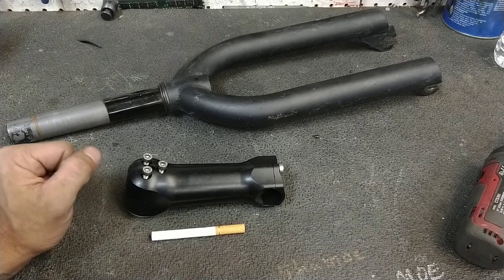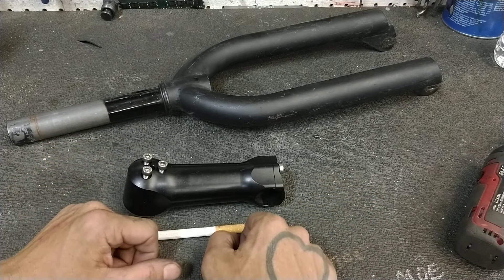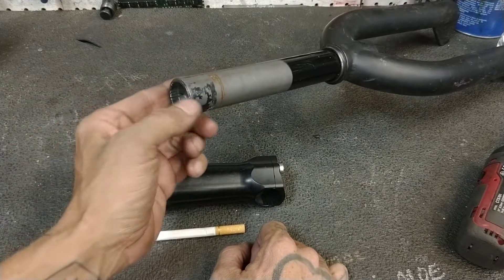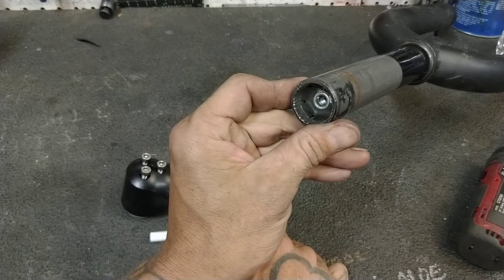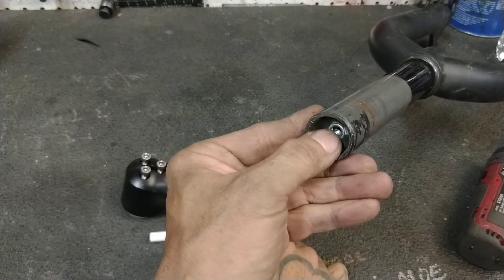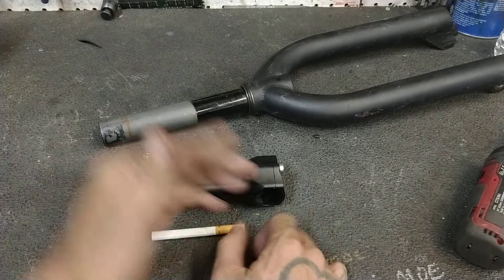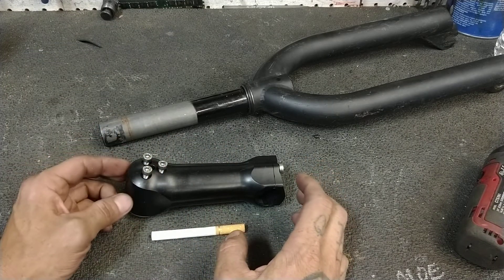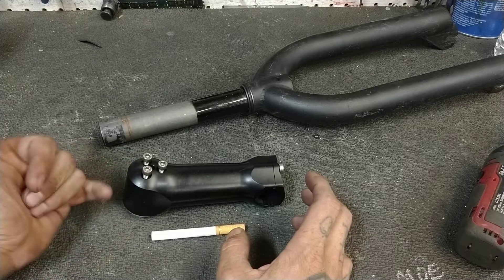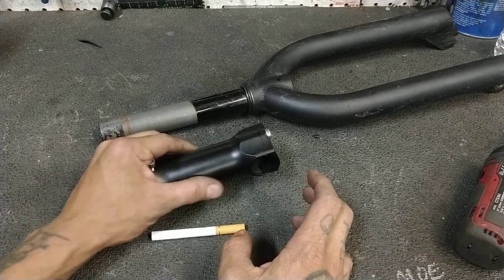Got an interesting one for you tonight. We are used to, fundamentally, modern stems clamping onto the outside of the steer tube of a bike. This is an inch-and-an-eighth steer tube — a BMX fork, not a BMX stem. You notice it has no threads on it whatsoever. The top cap will be drawn down into what's called a star nut, or more precisely, a star fangled nut, which I think is hilarious. Once the proper preload on the bearings has been achieved, you simply lock down the two bolts — or one bolt, or sometimes four bolts if it's a crazy-ass stem — found here.